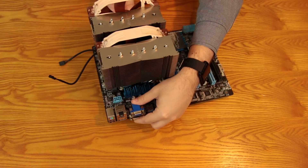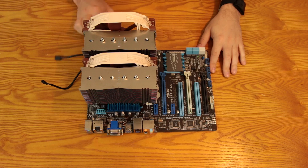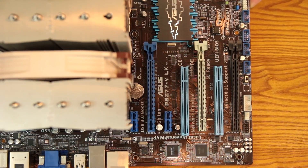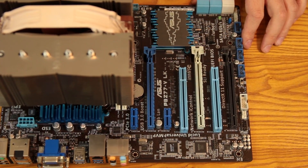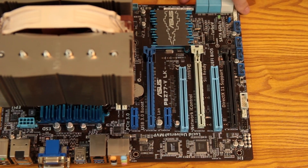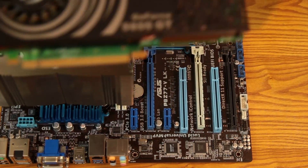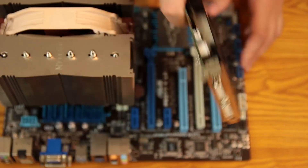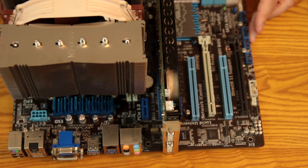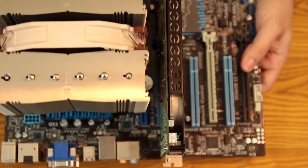This thing really is heavy. We also have to look at clearance on the PCI Express side of things. The very top PCIe slot is actually slightly obstructed by the cooler itself, so if you wanted to put something in there, you're kind of out of luck. However, the good news is on this particular board layout, the X16 slot you'll be using for your graphics card is the second one down. Taking a graphics card — this is a 9800 GT — and seating it in there, you can see that with the graphics card installed, we don't have any clearance problem as long as you're on the second slot down.